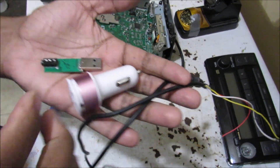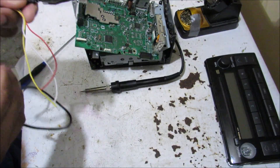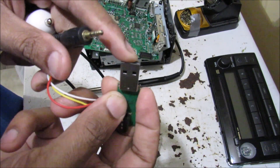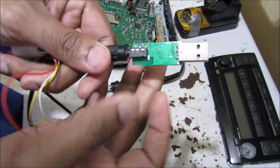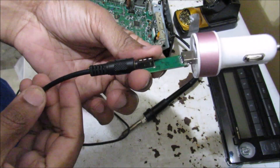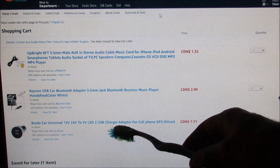Now with the radio all apart, we come to the main components required to make everything work. First is a 3.5mm jack and cable from the dollar store for about a dollar — I've already stripped the wires on one side, and the other side lets you plug in any phone to play music. For iPhone users we're going to take it further and connect a Bluetooth module to the auxiliary line. These can be had on eBay for about three or four dollars — it takes power from the USB side and creates a Bluetooth connection so your phone plays out to the aux line. The final piece is a power inverter from the dollar store for about two or three dollars, which converts 12 volts from your car to the USB connection needed for the Bluetooth module. All in all this hack can be done for about ten dollars, and you'll need a soldering iron.